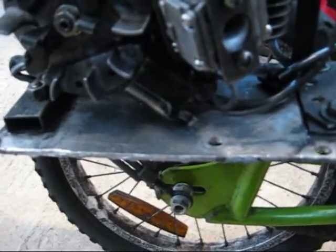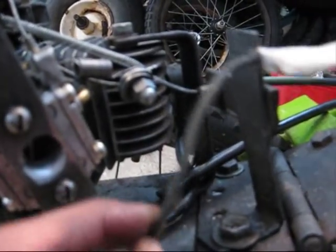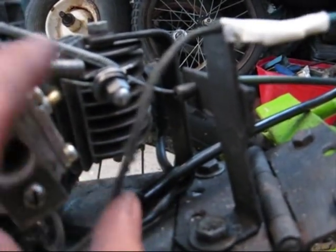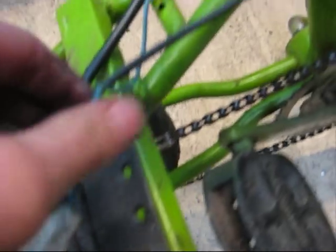Now I'll do the kill switch. All small engines like this will have a magneto — that's this black part. It'll have one wire coming out of it, which is this one here, and this would go to the kill switch on the machine. But since the kill switch is down at the motor, I had to extend it, so I just connected it up with this spade clip under there and taped it all up. It goes all the way up to the handlebars, to this switch here.